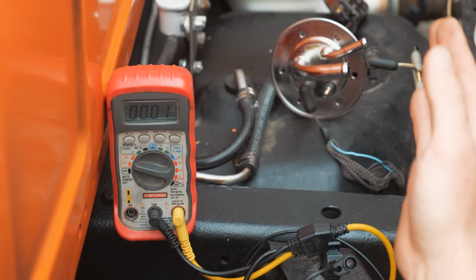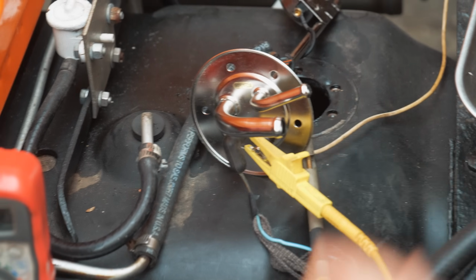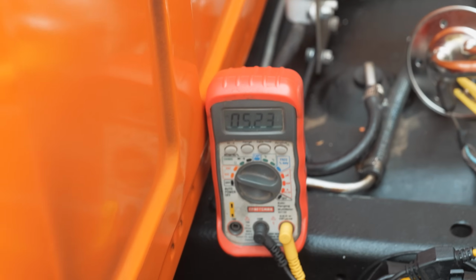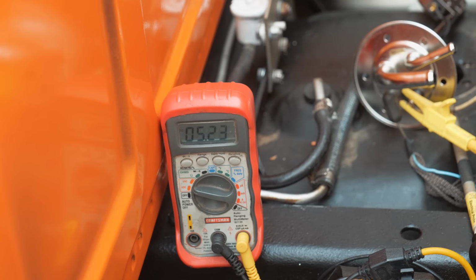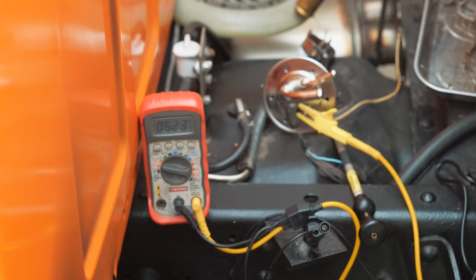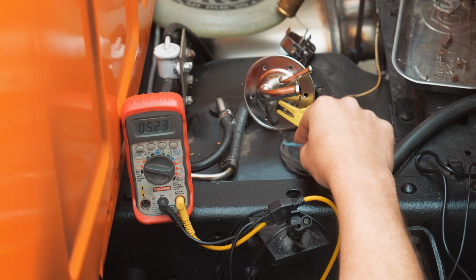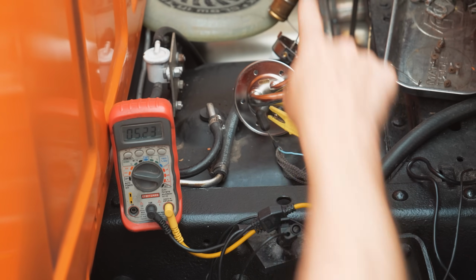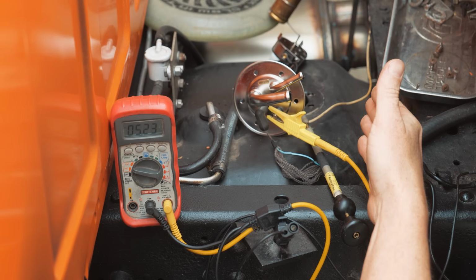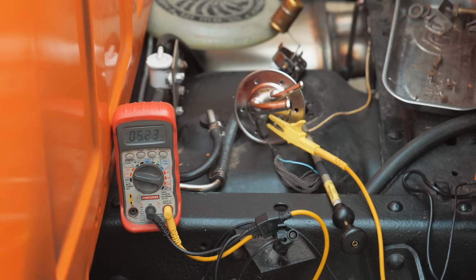That circuit needs to be loaded, okay? So I need to go on the pin to show you this. I'm gonna read 5 volts on this pin. Loaded circuit voltage drop test. And this proves again that the tests that we did were accurate to say go inside, because if that ground was bad externally, we would have read exactly that: 5 volts, which is the same as the source going in. That's the ground pin. This is the sensor wire, signal wire, sending unit wire, feeding in, going to the float, going through the resistor, no voltage drop because there is no current flow with the open ground. It doesn't matter that it goes through all that resistance, the pressure stays high and you'll read 5 on that ground. And that's your measurements.